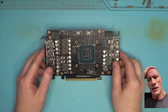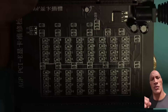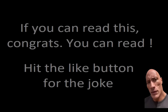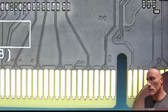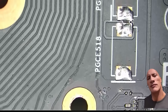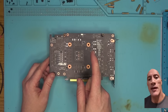It was at this moment that I knew I missed something. And then there was this tool that I called the Data Line Tester, which says that we have an issue with the data connections on the back of the card. As I started looking around, I found a ripped off capacitor and some scratches, as well as damaged traces that are used by the motherboard and the GPU to set the communication frequency with each other. Since these were damaged, the motherboard could not detect the card, so let's fix that and see if that helps.